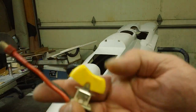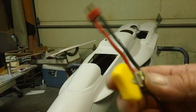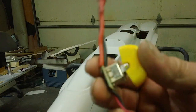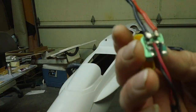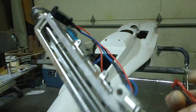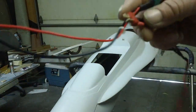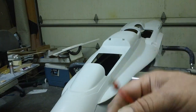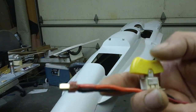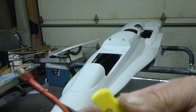Forward, reverse. I just googled 3-position switch on the internet, and I got a bunch of them. Some already have reverse built into them, some you gotta wire up yourself. This one is already reversed. But why can't I just plug this into there and do away with that remote control car speed controller? I just have to have a servo move this. I'll take this off and rig me something up, or get one of them other switches and use a servo.